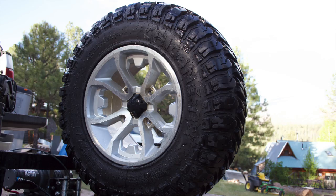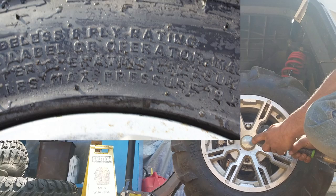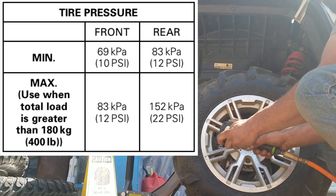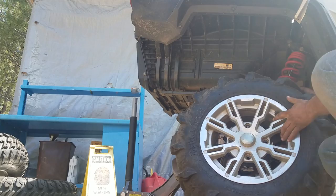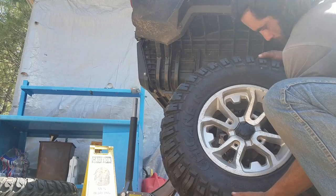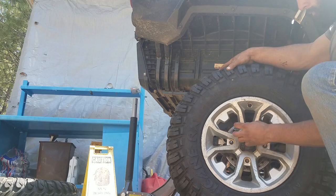As tempting as it is to just set it to the max cold PSI labeled on the sidewall — in this case 18 PSI — that's apparently just the pressure to set the bead to the rim. For optimal performance, we need to find the sticker on the machine or check the operator's guide for the correct PSI. Comment below what tire pressure seems to work best for you in your riding environment. The tire shop had over 30 pounds of pressure in mine when I got them back, which explained why the bike felt really top heavy, twitchy at speed, and like it might tip over in every corner before I remembered to check the tire pressure and lower it to the correct PSI.